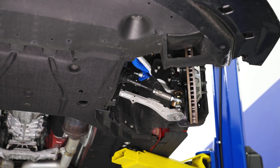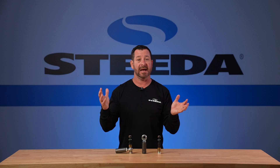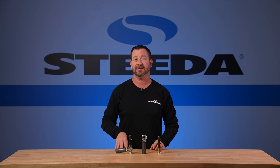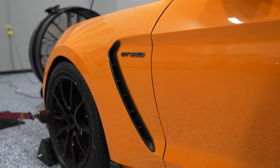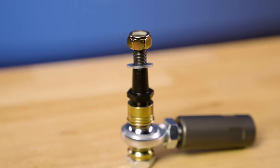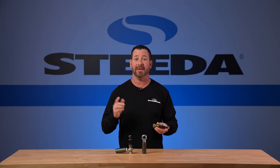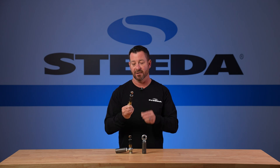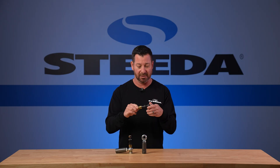This is our brand new S650 kit and the whole kit is different. When Ford comes out with the new S650 they make things better. At first we thought they're using the spindles off the GT350 in the front, but they're not — so it required a brand new tapered stud. Some of the other kits on the market include just a bolt and they make you drill out that tapered stud. Well, it's your steering. Ford puts a taper lock in this for a reason — you don't want it coming loose.